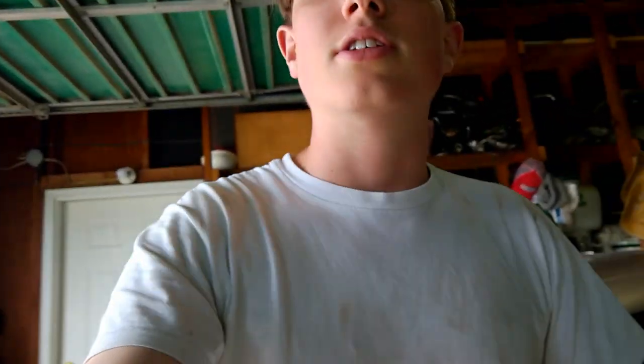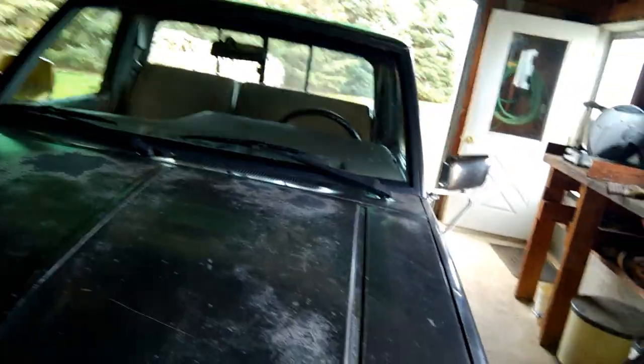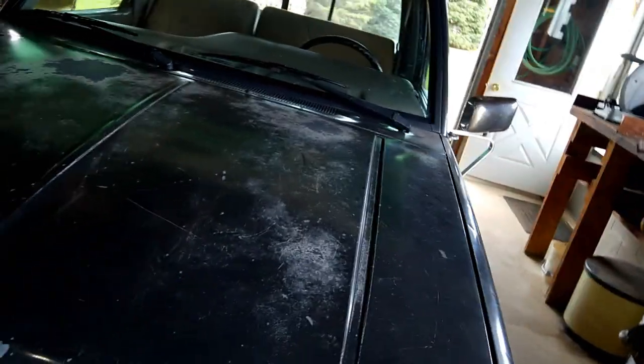I had to build up pressure, so that was either the fuel filter being plugged or the pump not making enough pressure. I'm hoping it was the fuel filter, but we'll have to see. This thing is still running, no drips yet, and it idled outside for about five minutes and revs up great. We've got a couple big projects coming up — one I just picked up the other day, I can't wait to show you guys. Stay tuned for next time, thanks for watching. Like, share, subscribe and I'll see you next time.